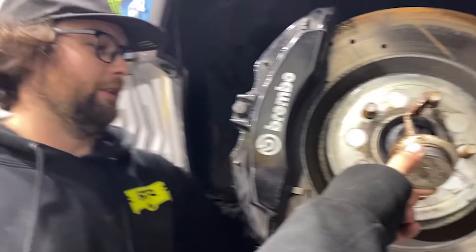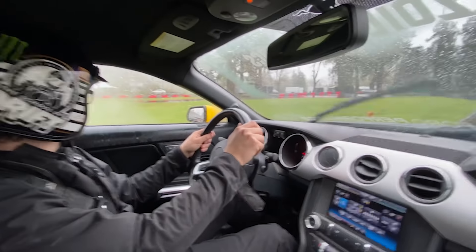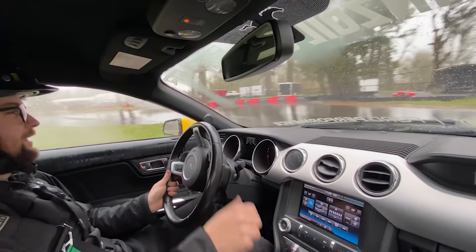We wanted to do some real world driving on it and adjust some things and get it set up properly. You're probably looking at this like - what is going on? This is an insane lower control arm. And it is. The stock setup is a dual pivot instead of a single pivot, so we've gotten rid of that, which will really increase the steering feel and allow the car to drift more like a natural, old school car. It's a two-piece design bolted together with sandwich plates.